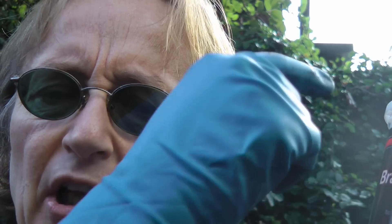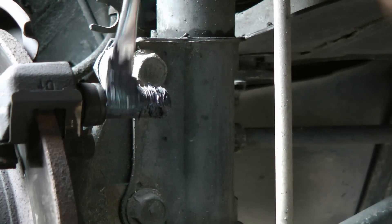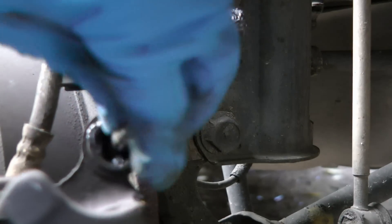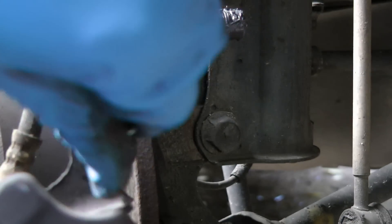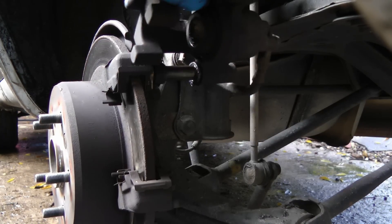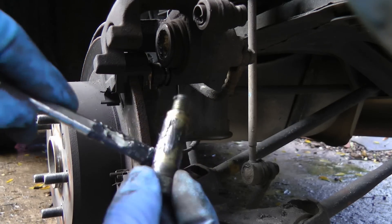Then you get some brake and caliper grease and coat it with a layer of grease, which is going to lubricate it so it doesn't stick anymore. We'll also put a little grease inside the caliper assembly so that slides better. Then the caliper just slides right back on — as you can see, now it slides real easy. And of course, lubricate the bottom bolt that it slides on too.